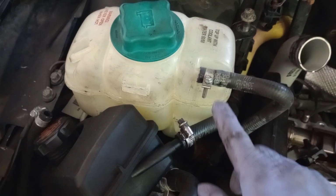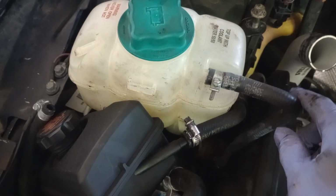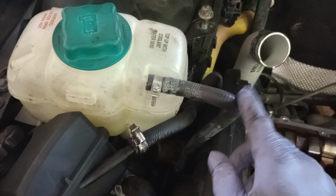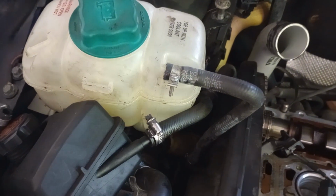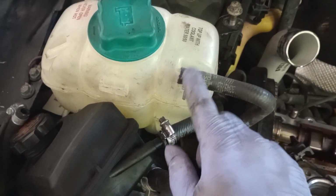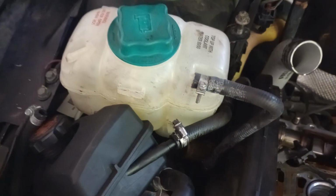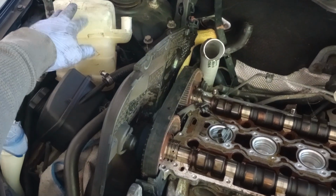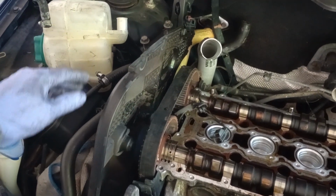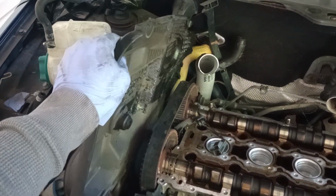And almost forgot. So the small hose, you can undo it right here. Be careful you don't pull on the other end, because you might break the line. And if you break that line, there's a pipe down there you're gonna have to replace. But make sure you undo the small water hose up here. So once you remove the water reservoir away, then you should be able to play with the cover and remove the cover out.